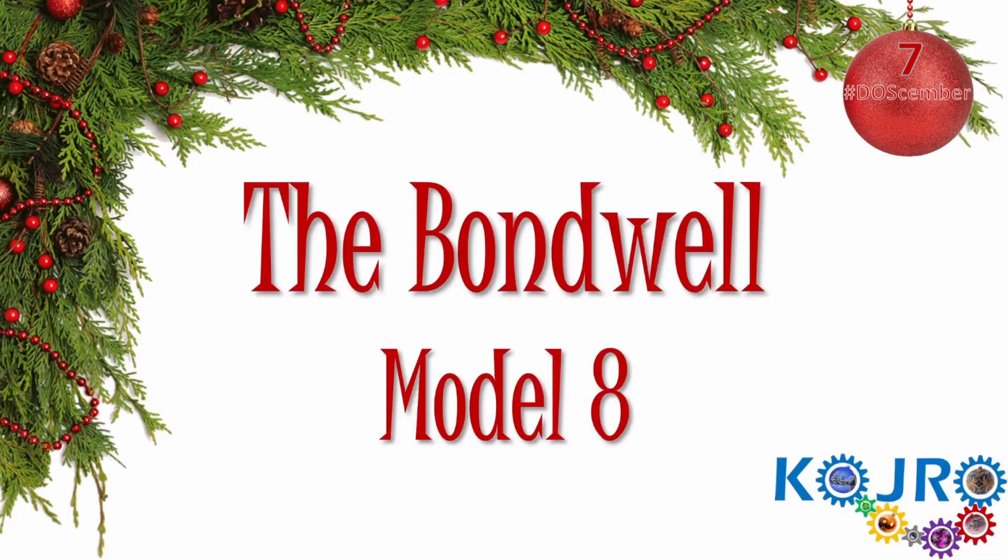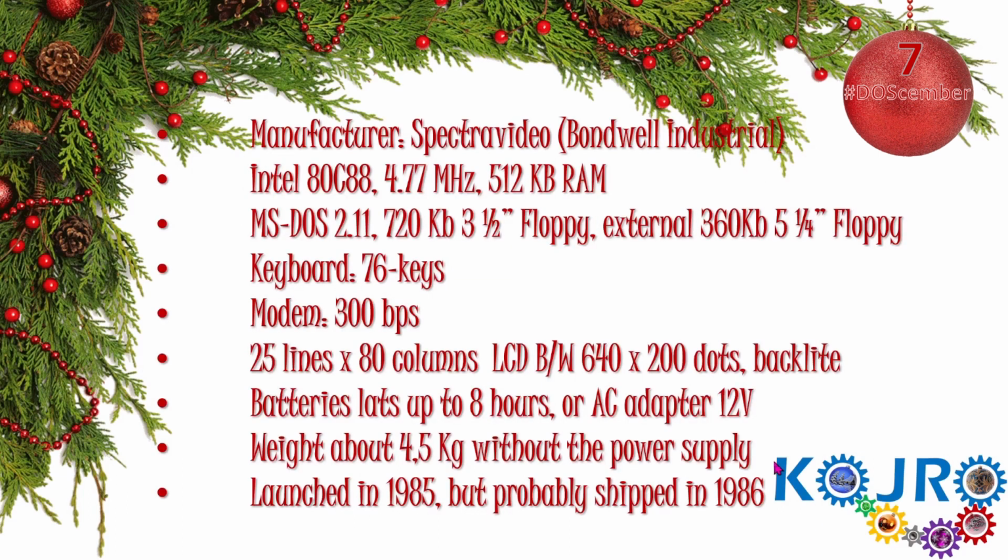This video is featuring the Bondwell Model 8 laptop computer. And Bondwell was at this time a subsidiary of Spectra Video that produced a line of home computers and later MSX compatible computers before they moved into CP/M computers. And the Model 8 was one of their first, if not the first, MS-DOS compatible computer they manufactured. And it's based on a CMOS version of the 8088 running at 4.77 MHz.